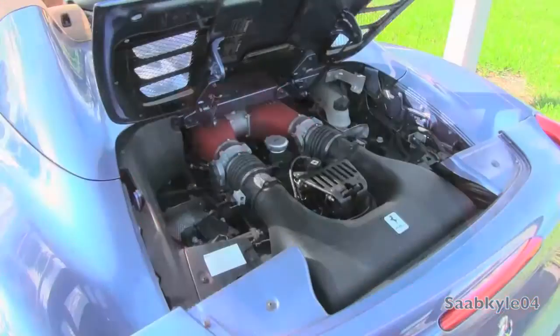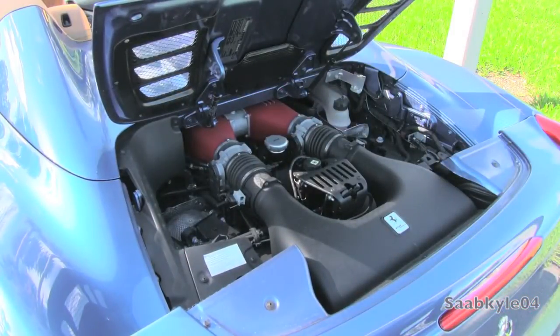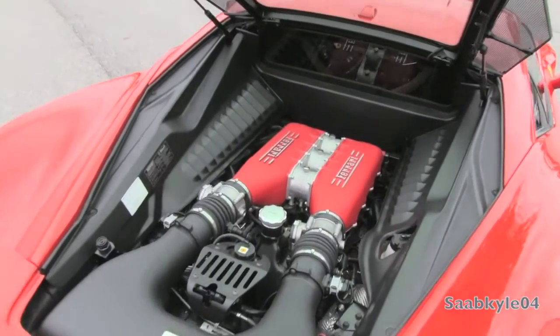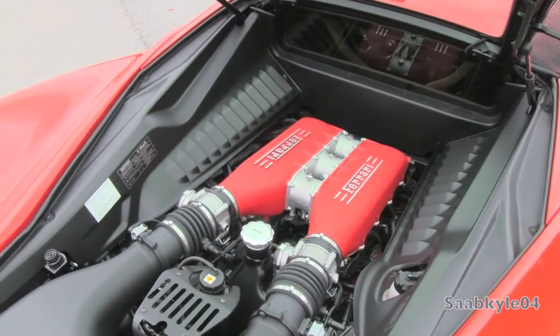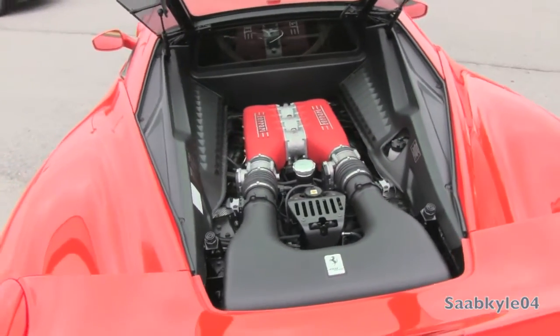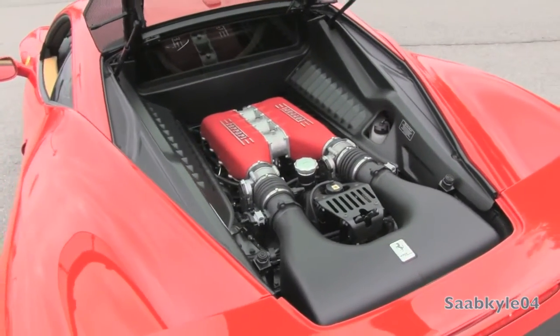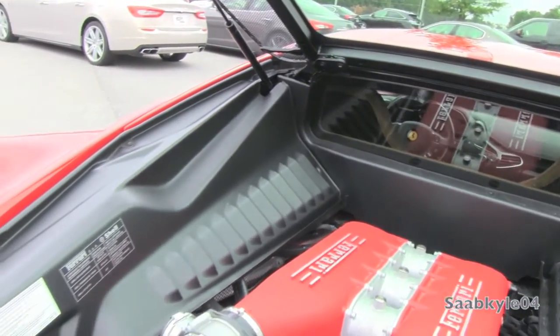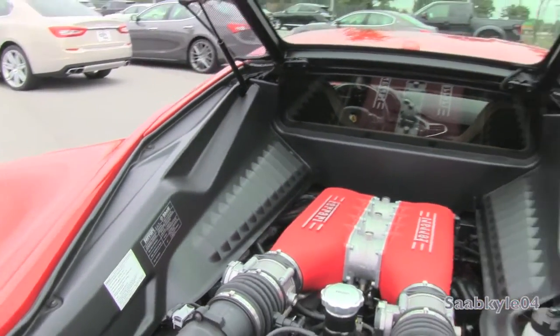The new generation of naturally aspirated V8 engine also shares a few elements with the 4.3 liter mills found in the F430 and California, such as bore centers and basic block configuration, but that's basically where the similarities end. At the time of its debut, it set an entirely new benchmark for its segment and for Ferrari. It's also a far more efficient power plant, not only in fuel consumption, but in the way it delivers and releases its power. Improved air delivery, reduced pumping losses, and a substantial reduction in internal friction help harness every pony possible.